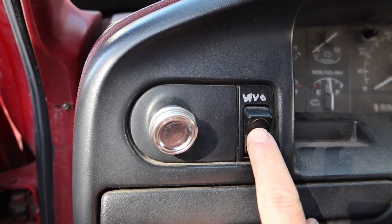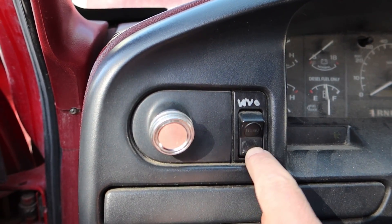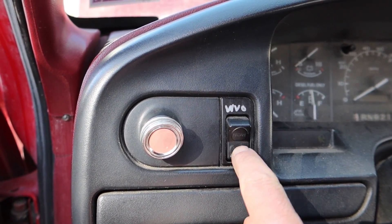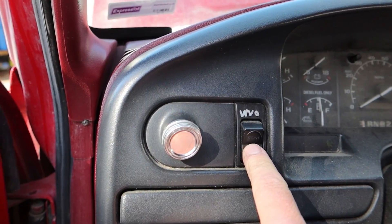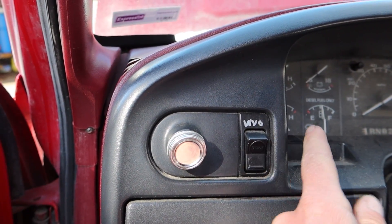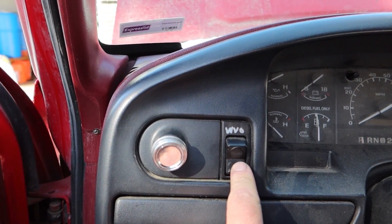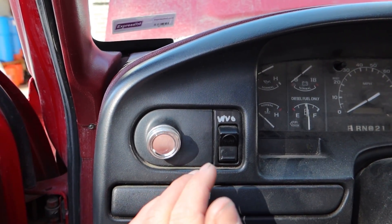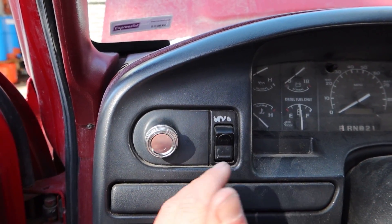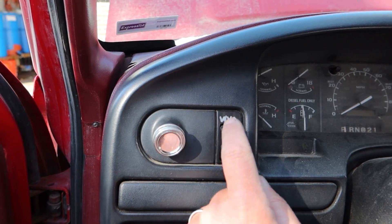So this is the switch — the ever important switch. You'll see here it says 'diesel fuel only' — we're going to disregard that. The back switch is for the back tank. We purge the system on diesel, so everything right now with the truck not running has diesel in it. It's pretty chilly out so I wouldn't want to try and start it on vegetable oil — being viscous, it just wouldn't really work. So when the truck hits temp — I can see the temp gauge here — when it gets towards the N or the O of 'normal,' I know the thermostat's on. I can feel under the truck that the coolant lines are hot and heating the fuel lines in the front tank, and then I'll switch to the front tank knowing that the warm vegetable oil will flow through the system without any issues.